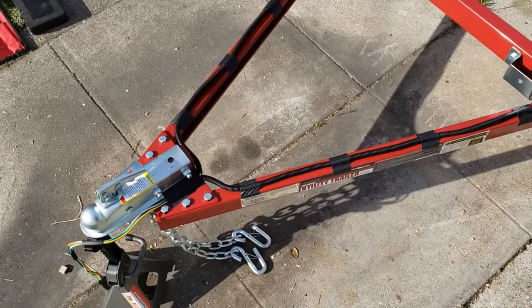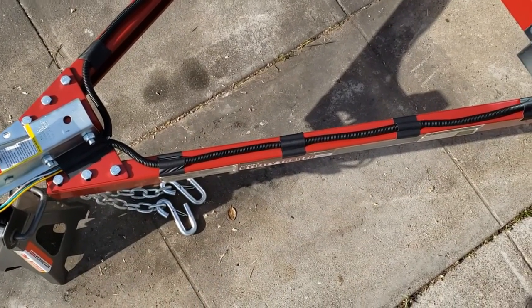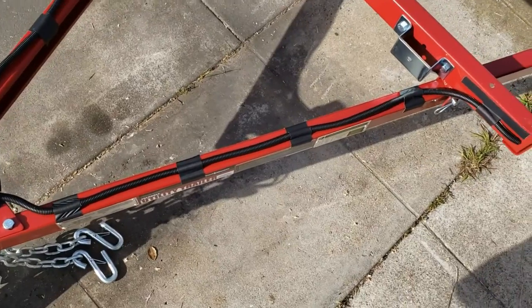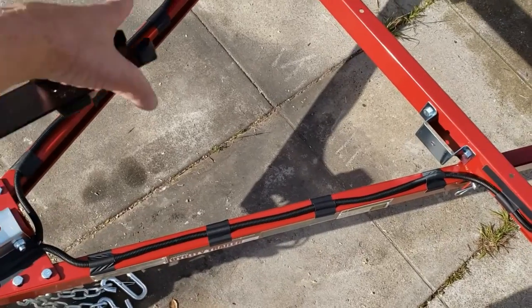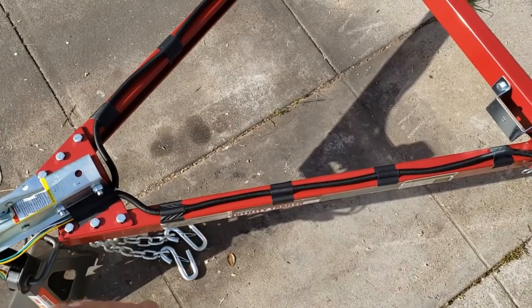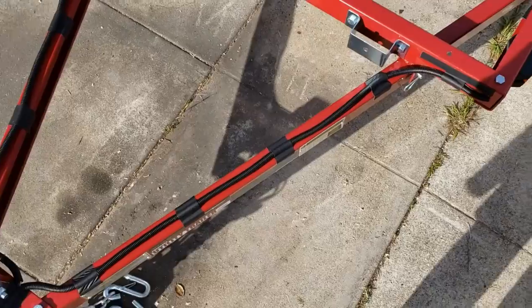fold down. So as you can see, all I've done is I've taken some plastic conduit and taped it down to the framing with gaffer's tape, which is a temporary thing. I'll figure out some other solution to that, but I just wanted to show you the reality that you're going to have to come up with a way to completely disconnect all of your connection points for your conduit or your wiring from the tongue if you want to fold it down. Or you're going to have so much slack in there that it can adapt to taking that big swing down.